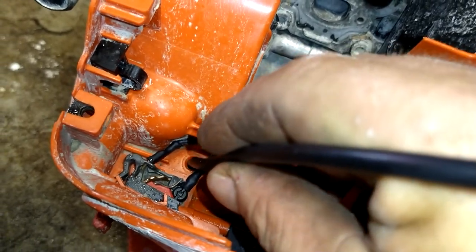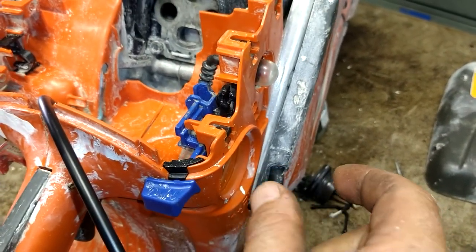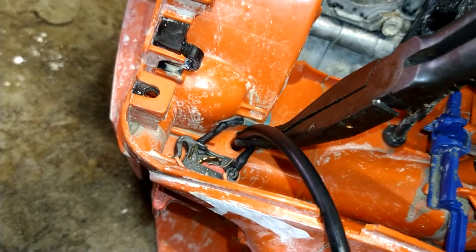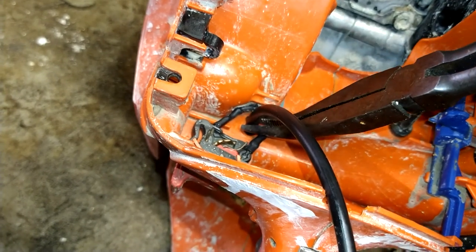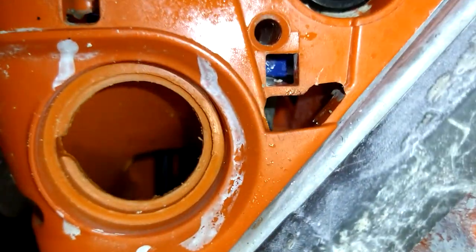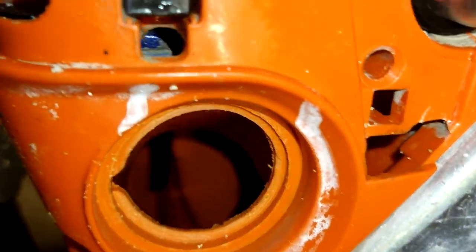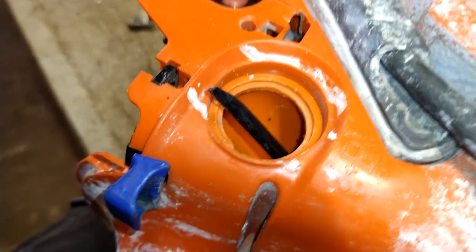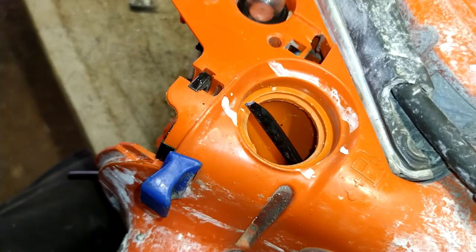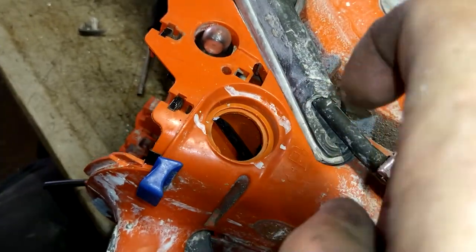You're going to stab it in here, then work it down in there as good as you can get it, until you can grab it with some needle nose. You're going to pull the fuel line out of where the gas cap goes. Grab it just a little bit above and shove it down, then drag it up just a little bit and push it down — just keep working your way in until you can see it sticking out. I got it down in there a decent amount; I'm going to grab that with needle nose and pull it out. If you don't have long enough needle nose, keep shoving until you can grab it — or you can take a clothes hanger, do a little hook on the end, and reach in there and grab it and pull it right on out.